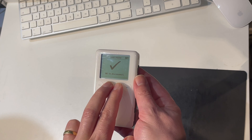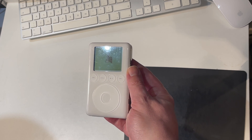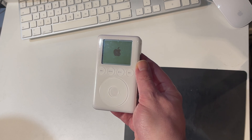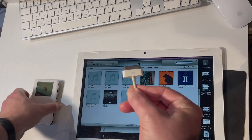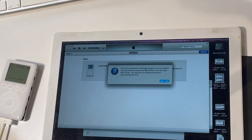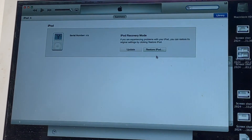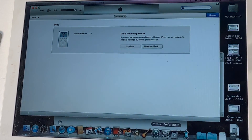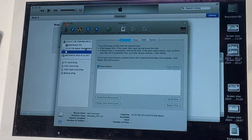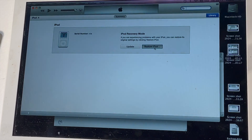When it came to restarting the iPod to perform the update, you press the two buttons, wait for it to boot up, and then you're waiting for a dock connector icon to appear. But instead I got the broken folder symbol. So I knew I needed to repeat the process — plug it into the Mac and do it again. I plugged the iPod back into the MacBook using the USB cable and an error message popped up saying we've got a corrupted iPod. I switched over to Disk Utility where I could see it was appearing as a disk. All I needed to do was unmount the disks, switch back to iTunes, and this time definitely press 'Restore iPod' rather than 'Update'.